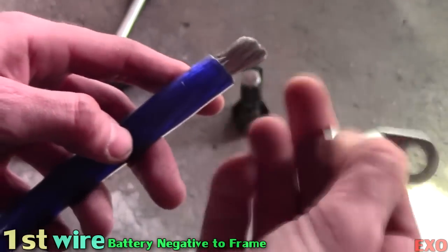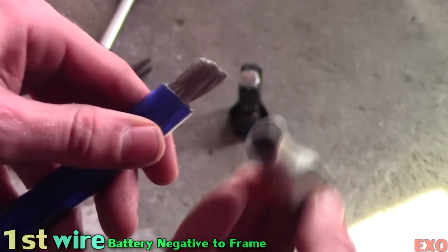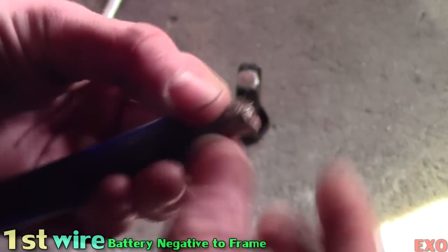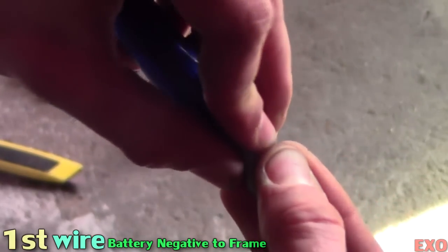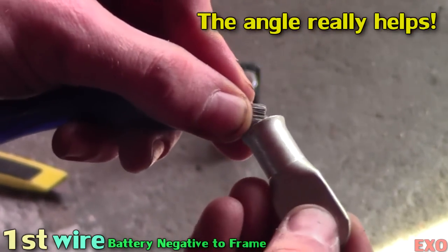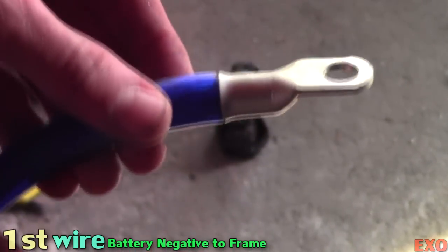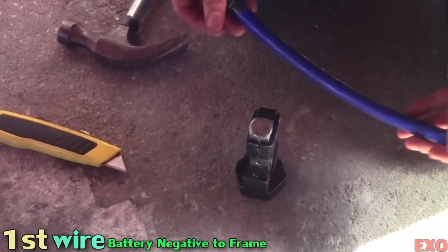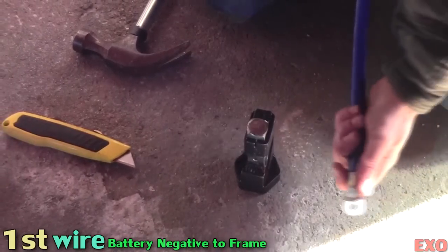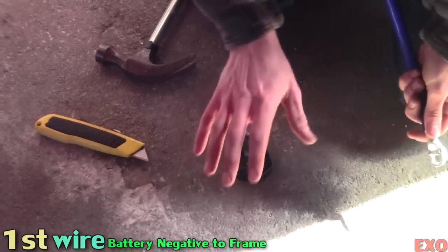Once she's stripped, go ahead and get your terminal ready. I got a nice little trick to get this big chunk of wire into this little tiny hole if you ever have trouble with it. What I do is take my three fingers like this, push it up, twist with my other three fingers, then hold once more with those same three and put this on at an angle. That's how I do it. Now depending on if you're soldering your connections or hammer crimping like this — I have a closed space terminal right here — I'm gonna use no solder at all and crimp them right into the copper.